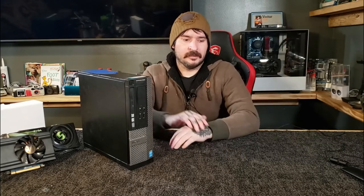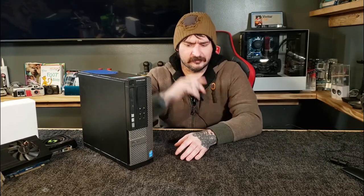But the main thing is it's up and running. So we saved another OptiPlex. It's pretty much a simple fix — I overcomplicated it. I should have just gone straight to checking if Windows installed. I had to take it to my other desk, hook it up to a little monitor, and once I got there I was able to get into BIOS from the Intel onboard graphics because it wouldn't display anything out. Once Windows was installed, it got a basic display driver and the GT 730 started working again. I tossed him another stick of RAM too — he's got two slots now, both taken. It should do him.